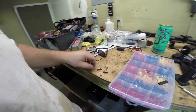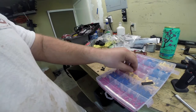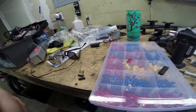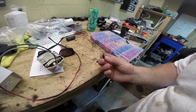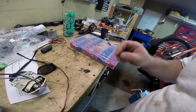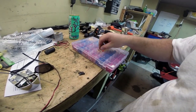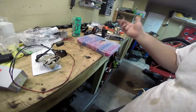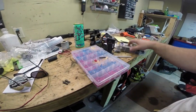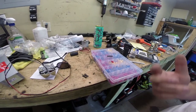A couple of notes about spade terminals. I always put the female end on the boat or car or truck, and the male end on the thing you want to be able to remove. There's no real rhyme or reason to that. Step two: take a piece of heat shrink and heat shrink it on before or after you crimp it. That prevents the two terminals from accidentally touching and shorting out — you can't heat shrink around the metal contact part, otherwise you wouldn't have conductivity. I had these dangling on the boat and the two exposed ends could spark and start a fire, so that's why I always do this. You can buy pre-heat-shrinked ones, but I already have a ton of heat shrink.